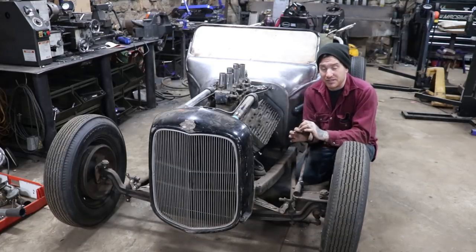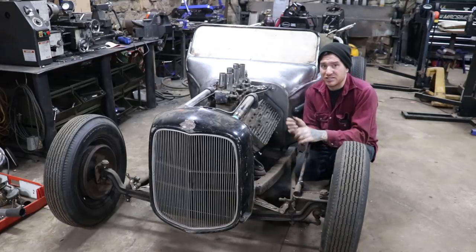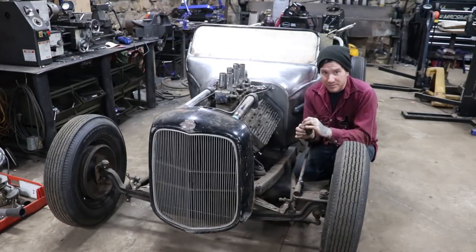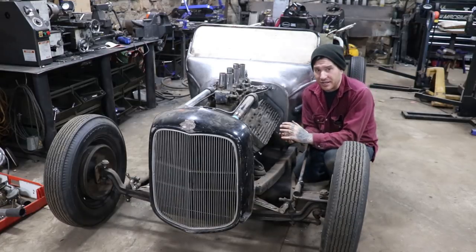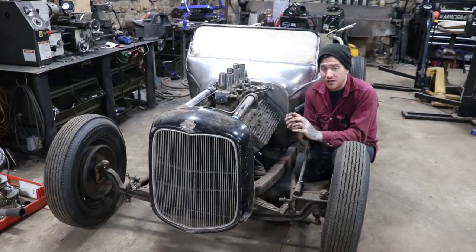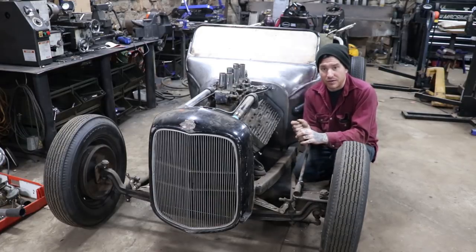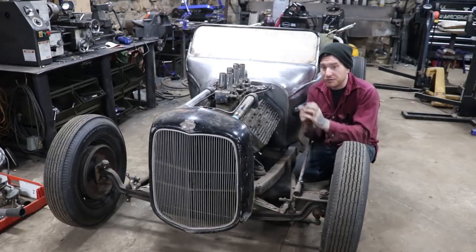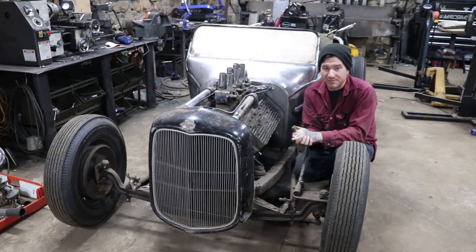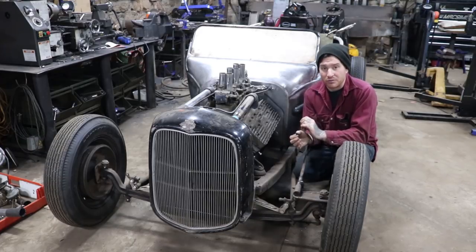Sometimes I'll make a little round circle and TIG it in place, but it often takes quite a long time to make those little pieces. As you get better at TIG welding and refine your skills, you can fill some pretty decent sized holes with some big filler rod. If you run it really hot and really fast and just shove the filler rod in, you can fill it up and probably put in not much more heat than you would welding in a little filler panel.